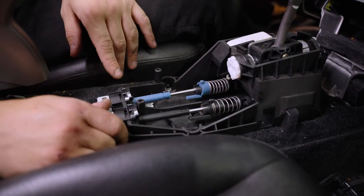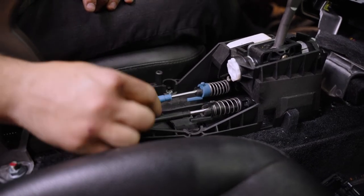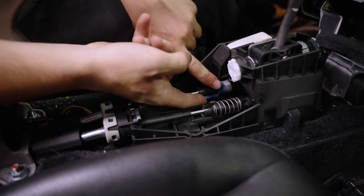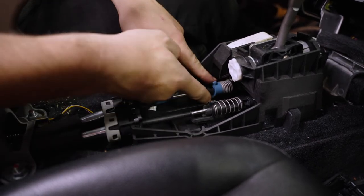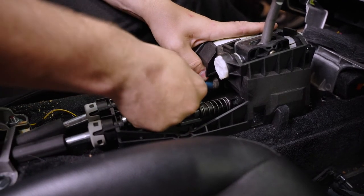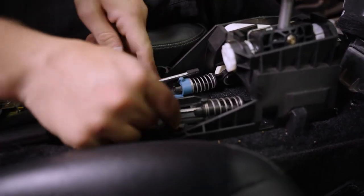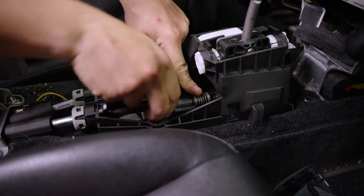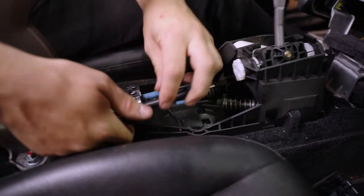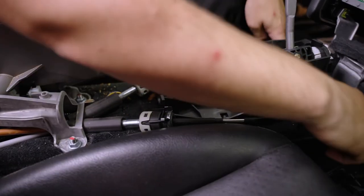Now with the assembly exposed, we are going to want to release these from the shifter cables. You push these forward and turn them — they self-lock if you push them far enough. Then you can pull these screws right out of the body. Do so on the other side. You have a released shifter once you remove these four screws.